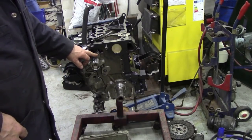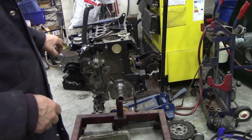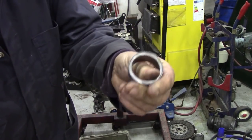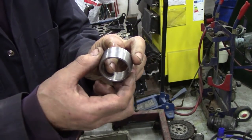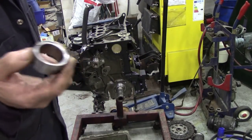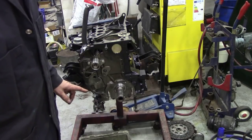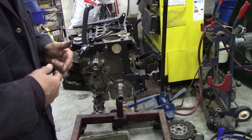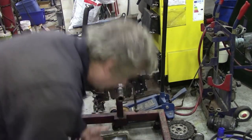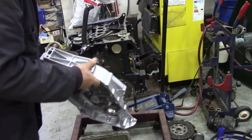With the plugs all tightened up and punched over, we're about ready to put the cover on. I actually took the injector pump off because I was having a bit of a struggle to get the cover off. This is a sleeve I had made to guide the camshaft oil seal over this shoulder because it is kind of tricky to do. It's quite common to bugger up the oil seal and make the spring jump off the back of the seal. So I've got the oil seals in place and they're all greased up.